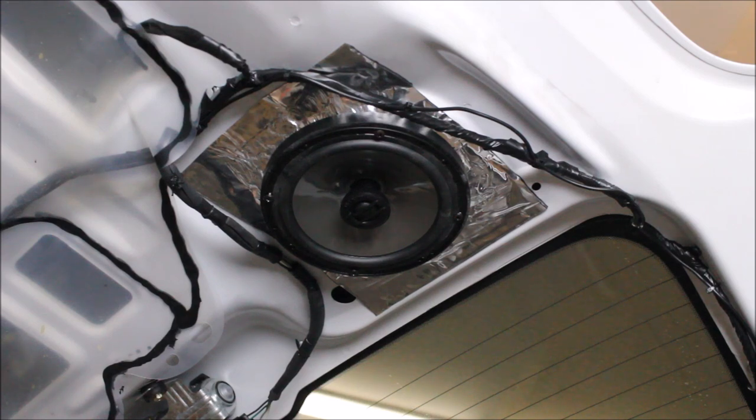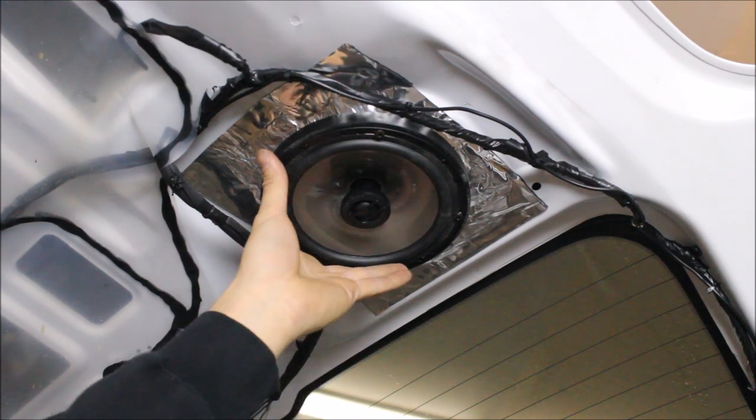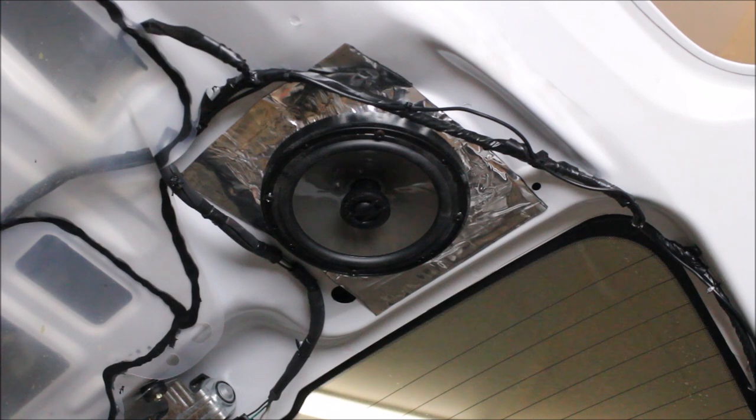One thing I have to say about the C2s is you really have to back them up with a subwoofer, and that's what we did in the first video on this van. You saw us put two 6-inch W3s in it and that's carrying all our bass, because compared to their C5s for example, when amplified they don't create a ton of mid-range bass even if you build the doors. So with the W3s and having the C2s all the way around we are going to get a lot of well-complemented sound in the van without being overbearing on price.